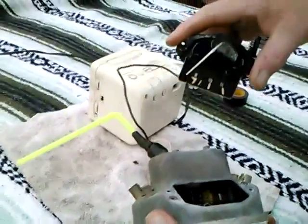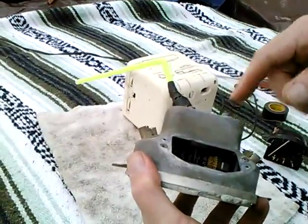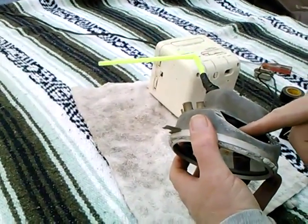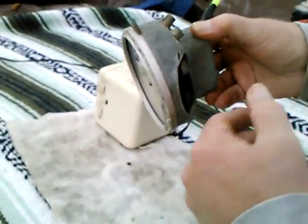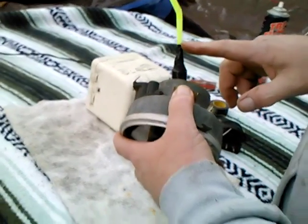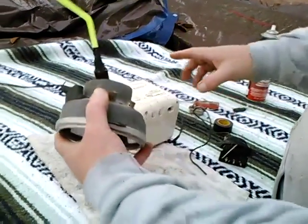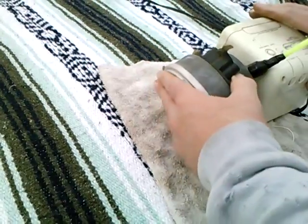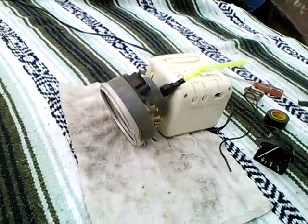I've removed the gas gauge along with the power stabilizer only to open up this space in the back. If any Tri-Flow leaks out of the gears, I want to keep it away from the odometer wheels and the dial, so it'll have this big opening to spill out of if there's excess. What I've done is electrically taped a soda straw to the speedometer cable input here, and I'll prop this up against — this happens to be a clock radio — to hold this position.